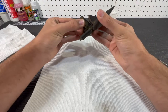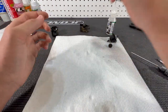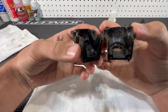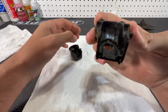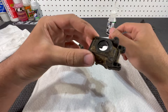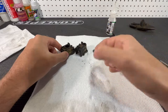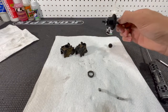I'm also going to wash this because this is where the spur gear sits and there's a ton of sand in there — we don't want that getting on the spur gear because it could strip it out prematurely from the extra grit. There's not a lot of metal shavings like in the front, just a lot of small dirt particles to get out. We're also going to clean the outside since it's caked with dirt. I'm going to pop out this bearing since we have good access to it — it's caked with grease. I'll work on getting all this cleaned up and put you guys back on when we're ready to install the rear differential.